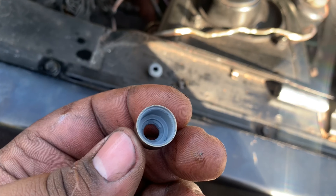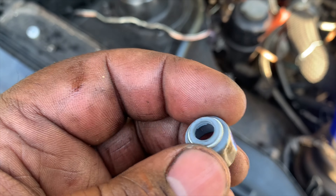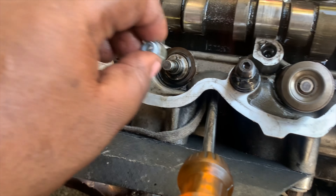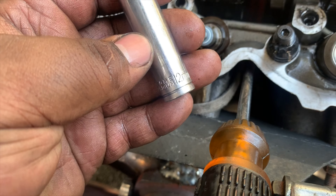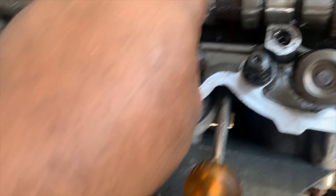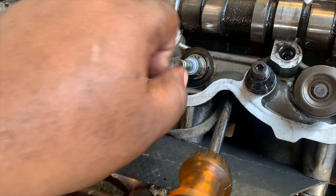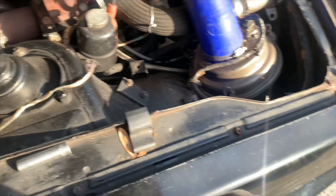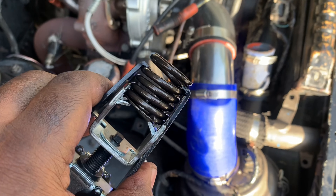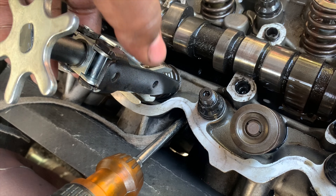You're going to want to take this seal and lubricate it — just a dash of oil to make sure it's not put in there dry. Then bring it over to the valve, slide it on, take a 12 millimeter deep socket, put it on top, and push. All right, now that is on and tight. Now you reverse the process — take your compressed spring, put it on top gently. You don't want this to pop in your hand; you'll have a spring shooting in your face, and obviously that's not fun.